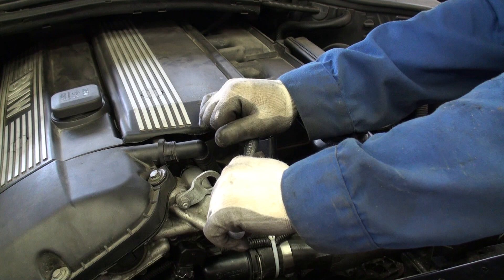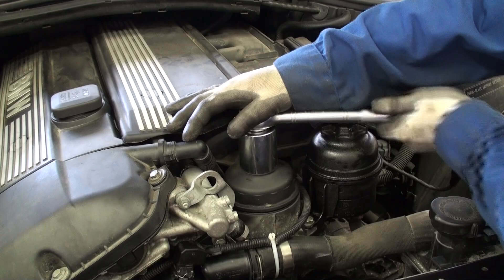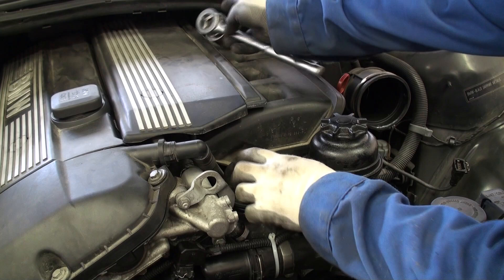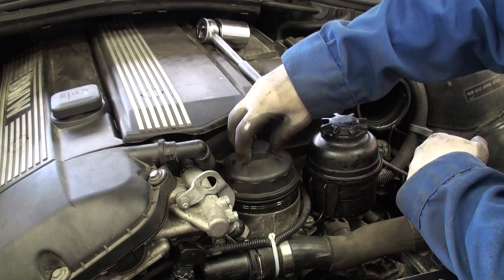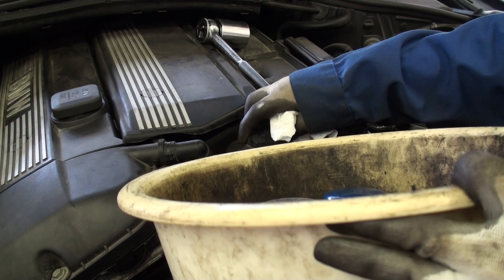You don't need to worry about oil coming out of this oil filter holder assembly. On the BMWs, they make it nice and clean and tidy to do oil changes, which makes it a pleasure to work on. You just unscrew it and then gently lift the assembly up, and the engine oil in the filter will run down into that oil filter holder where it will drain its way out to the oil pan. To keep the mess to a minimum, I strongly advise having a pan or small pail to catch any engine oil that drips out of the oil filter so you don't make a mess of your engine bay.